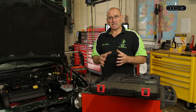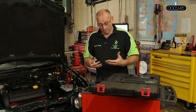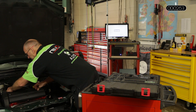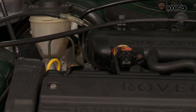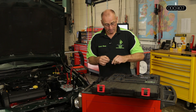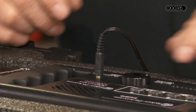When we do detect a sound or noise, what I'm going to do is take the headphones off and just place them near the microphone so that you actually experience the type of reception that I'm picking up through headphones. First device on an injector — obviously if I'm going to drive this vehicle that would be secured. I'm going to place one device just on top of the camshaft housing, three and a half millimeter jack — you'll have to excuse this whilst I set the sensitivity up.